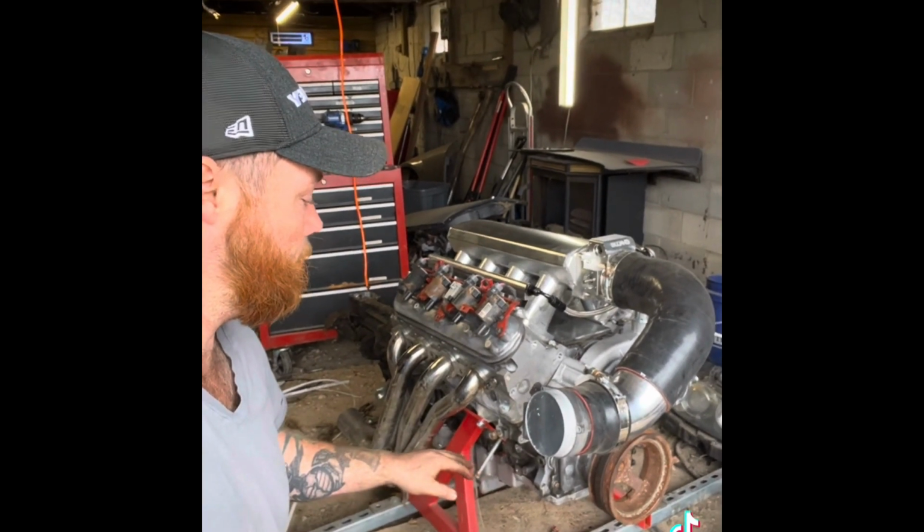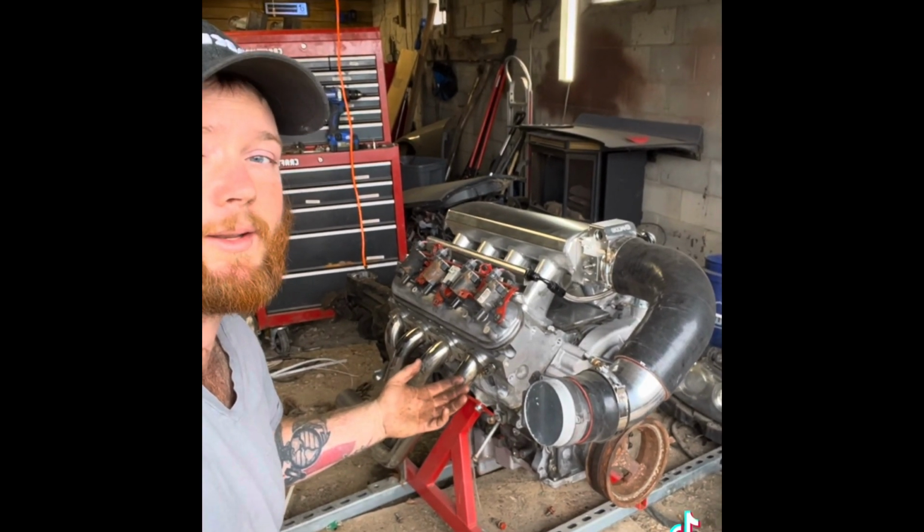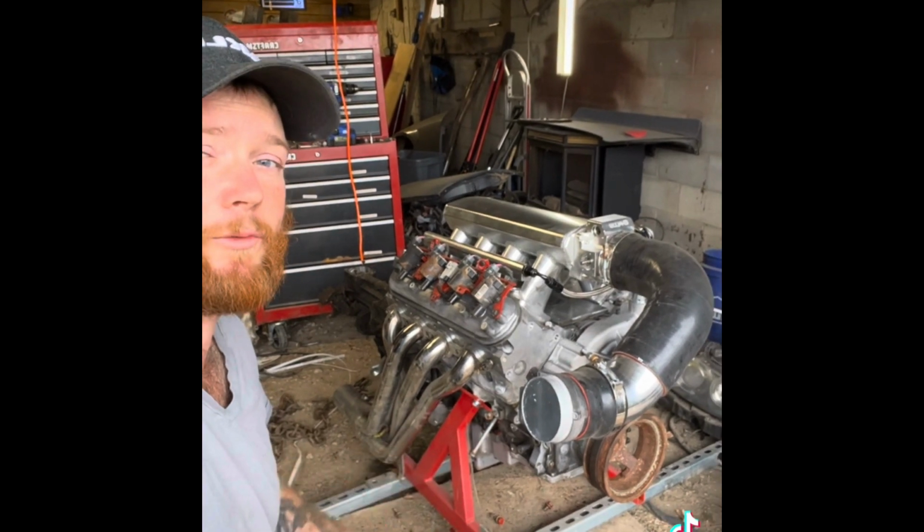The 3022 will hopefully give me the steering clearance that I need. When I tried this previously, I had a 3021 and it did not. I could turn my wheel about 1/8 of the way before it hit the oil pan.